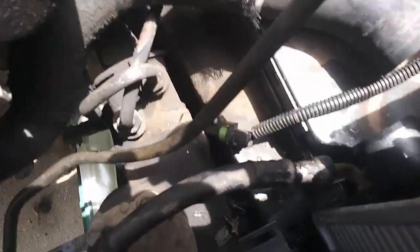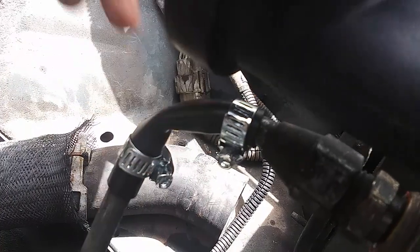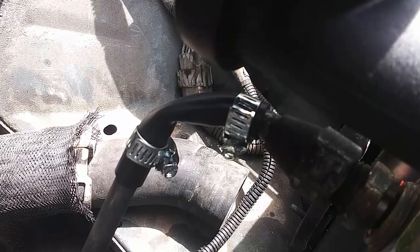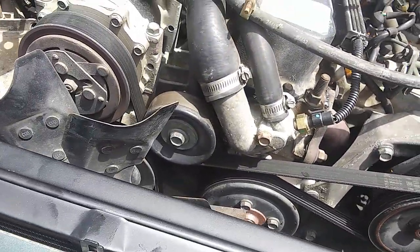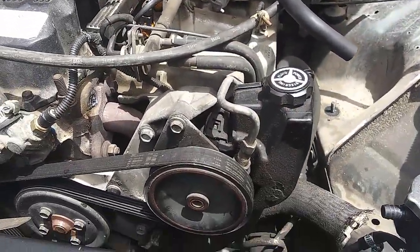I went to the auto parts store and got a quick disconnect tool to put this hose onto this new lower cooler line. And then we got this repair, which is just a piece of hose, because this line broke last night, as you already know. I wouldn't say it's the sketchiest thing I've ever done, but it should be okay until I can find a replacement line for this, because I'm having a hard time right now, but we will see. So next, I'm going to be putting the upper support bracket back on, and then we're going to fill this thing with coolant and see how it does. Gotta make sure there's no leaks.